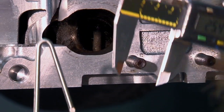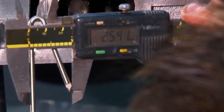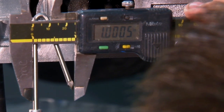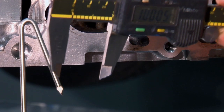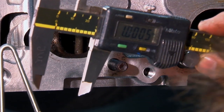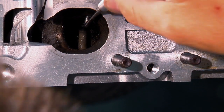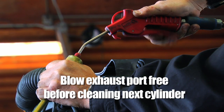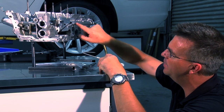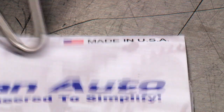Should you bend it slightly, that's not a problem — you can just bend it back by hand until you have approximately 25 millimeters (one inch) distance from the back of the hook to the tip. We do sell extra blades; they do wear out over time, and you can damage them if you're too rough and don't pay attention to coming straight in and out of the port. Altogether, it's very quick cleaning the ports: insert the tool, wiggle it through the carbon, and come all the way back out. This ensures every single port is flowing from the main galley through the crossover tube into every single port. And as always, all of our products are made in the USA.